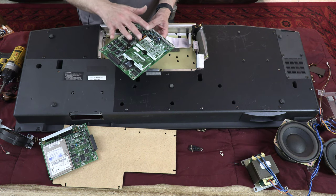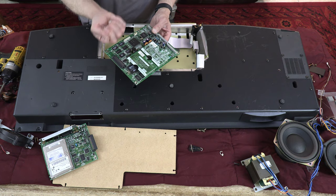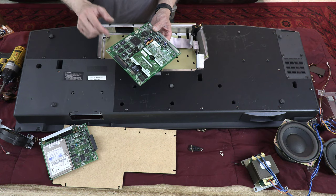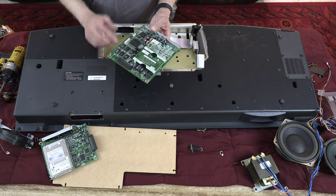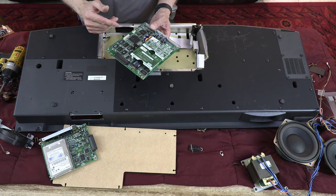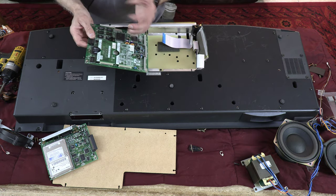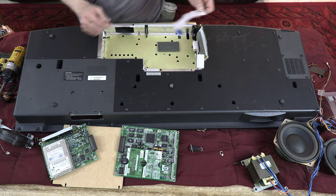This is, like I said, 15-year-old technology, so it's not like today's flash drives. A USB flash drive does not have a battery, because the type of chip that's in there doesn't need power to hold the memory, hold the information. But older chips needed electrical power, or, you know, DC battery power in order to hold the information. Okay, and if you remove this, it goes to factory default. Then you have to memorize all the songs again.